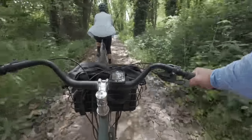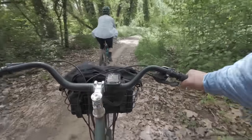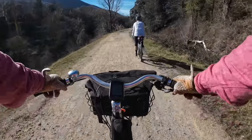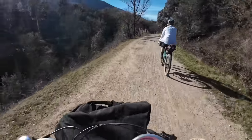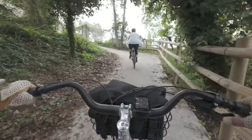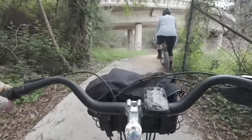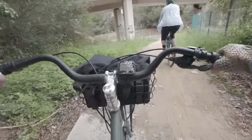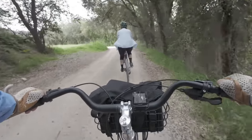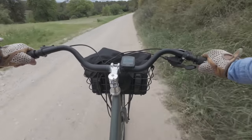I think this was a perfect example of how much a tire change can completely affect the ride of your bike. After all, tires are the only part of the bike that actually touch the ground. In terms of the handlebars, moving from the long stem with narrowish bars to the short stem with wide bars also made a huge difference. First of all, my body weight was shifted back, and that made the front steering a lot quicker and more nimble feeling — less like I was aiming the bike than actually steering it. The increased width also made the bike easier to steer with the basket and the front load, and generally gave me more of a sense of control, especially on the descents.